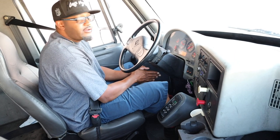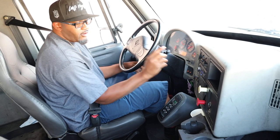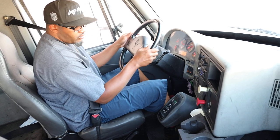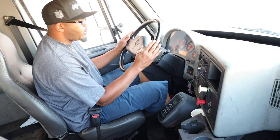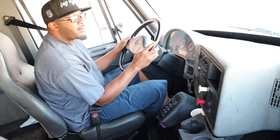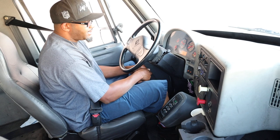I'm going to perform a brake test — a foot brake test. It's a simulated test. I'm going to get my speed up to about five miles per hour, release my tractor and trailer brakes, put it in drive, with my hands gently on the steering wheel. I'll get my speed up to about five miles per hour and push down on the foot brake. If my tractor and trailer goes to the left or to the right, I will take it out of service — it probably has slack that needs adjusting. That's one of the brake tests.